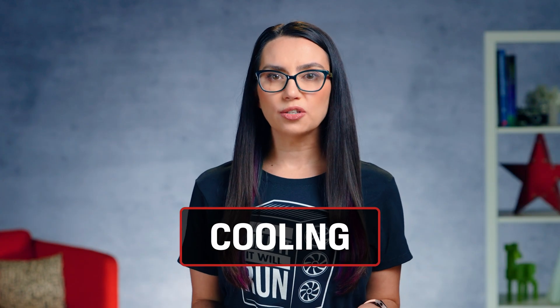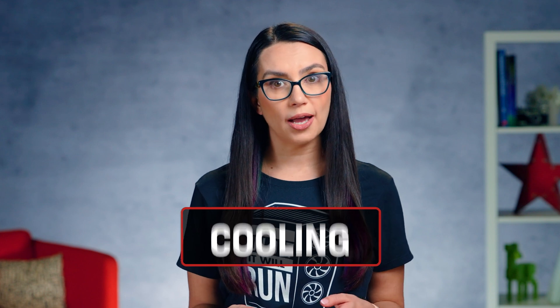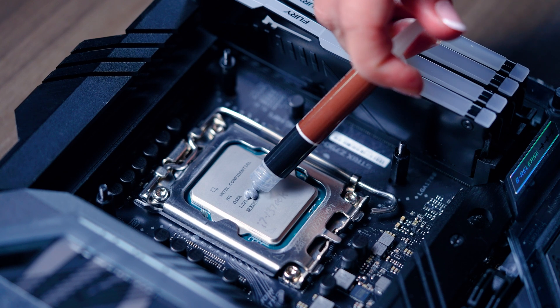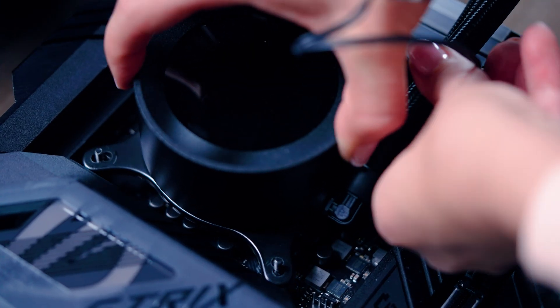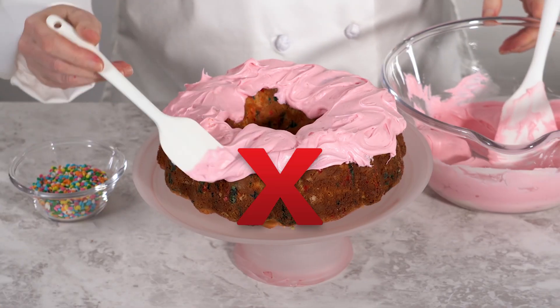Now for the cooling. If your cooling solution already has a thermal compound applied, fantastic — you can use that. If not, just use a wee bit and spread it around evenly. Some thermal paste brands even include a little spatula for this purpose. Conversely, you can give it a slight twist to help spread things around. Remember, a little goes a long way — it's not icing on a cake, so no overflow down the sides, please. If you are using a thermal pad that came with your cooler, remove any protective tape from the die just before installing, and be sure not to get it dirty. Don't try to use the thermal pad and thermal compound together — it's one or the other.